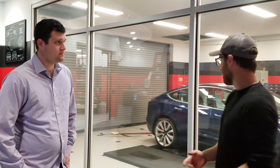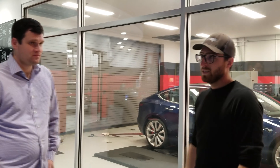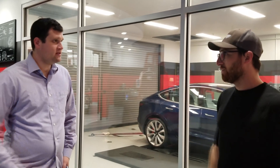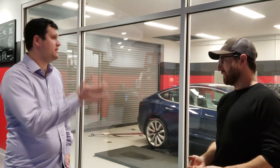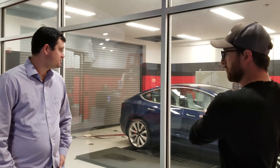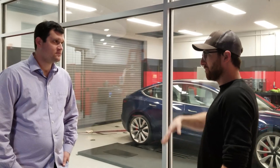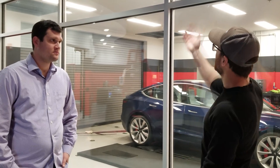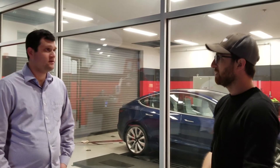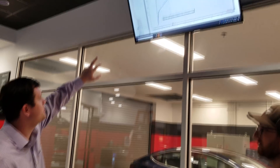We used the same calculation for both vehicles. And that calculation is not — for anyone on the internet — an exact reading pulled off the engine. It could be off by a point or whatever, so we made the assumption on the final drive ratio. That could adjust the torque. Things that could affect that: tire size — if you have a taller tire, which I believe both are factory tires, the taller tire could affect that. If you really want to get crazy with it you'd have to pull a tire track at the same time. But for general purposes like this, it's pretty accurate.